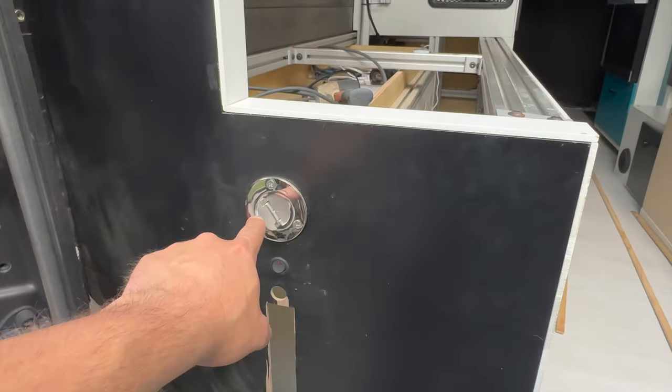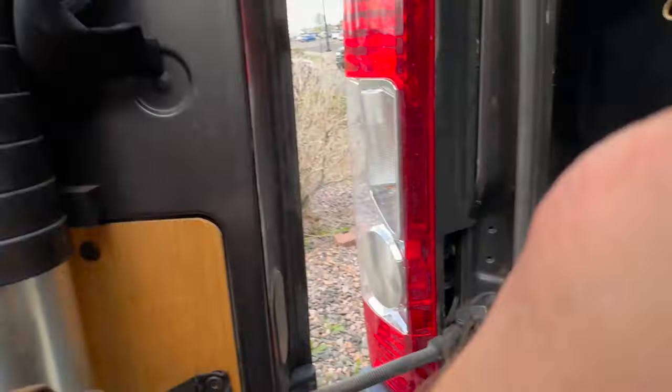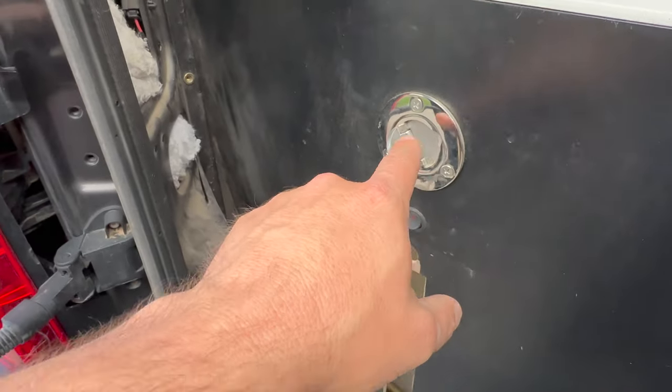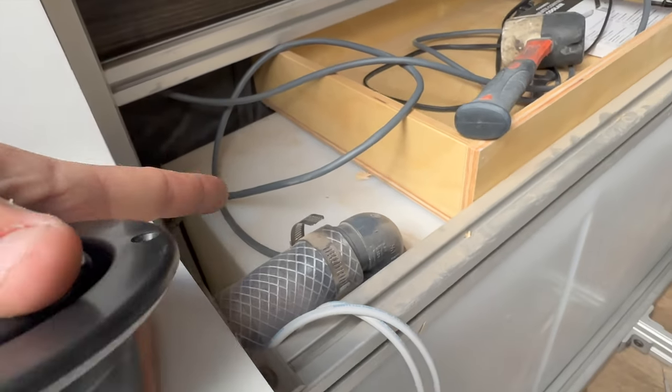There's one thing I've been wanting to do for a while and that's relocate my water fill. This is where I currently fill my water — this stainless steel thing unscrews and water goes into the tank through this tube here. However, if I'm not paying close attention, a lot of times I get water that comes out and gets all over the place, and I don't want water seeping into my wood paneling. So I'm going to relocate this to the outside of the van. I picked up a locking water fill — it's a durable plastic — and some new tubing. I'm going to turn the elbow 90 degrees, run the tube out the side of the wall, and mount this right there. It's black so it'll blend in with the van, and if I overflow the tank it'll just spill outside and not get inside the van.